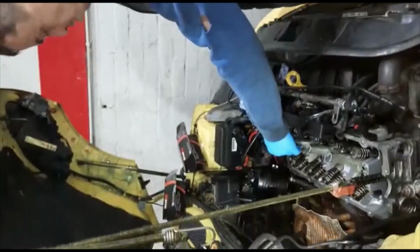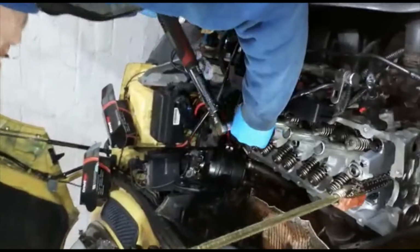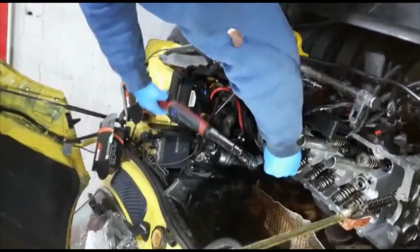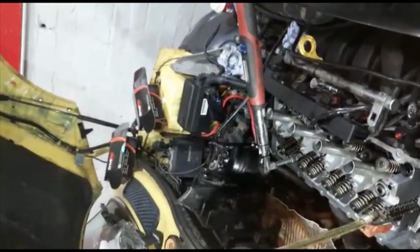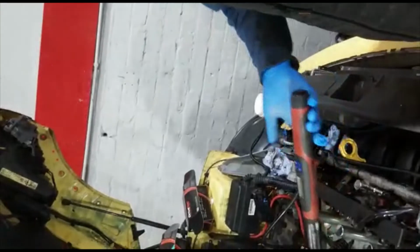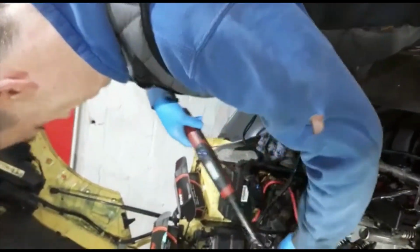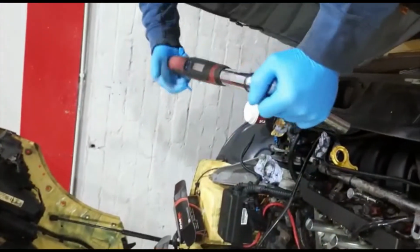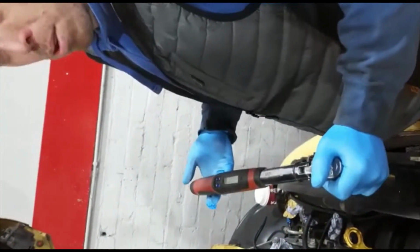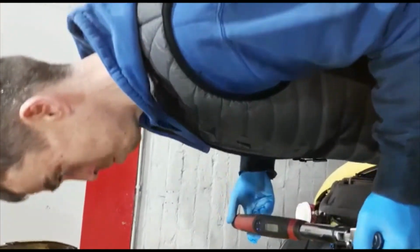There's 20 newton meters on. The bolt's at number 3. So that's the first stage, about 20 newton meters. My Tech Angle, Snap-on. It wasn't that expensive, honest. Well, a little Snap-on guy to help me. There's no issues with this cap. I've had two caps on this, but there's no issues with them.